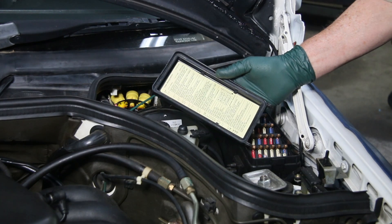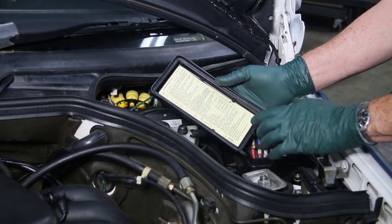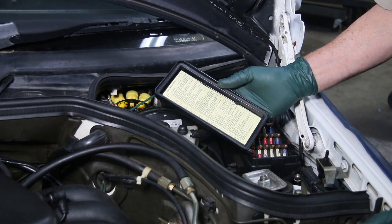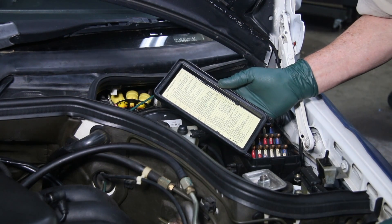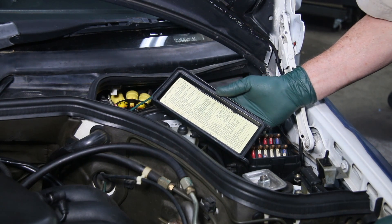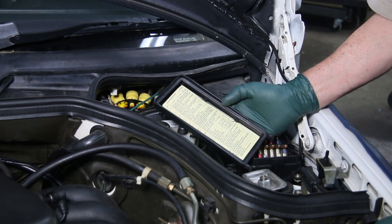How many of you have had problems with any of those items on any model Mercedes? One of the reasons why this particular circuit causes problems is that a number of these things run through the door and the trunk. When you're opening and closing doors and trunk, you flex wires, wires tend to break, and that causes shorts. Power antennas are also a real common problem — they get stuck and continue to drain the battery.